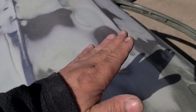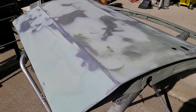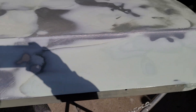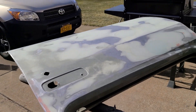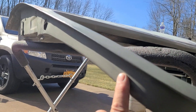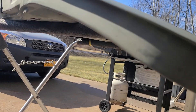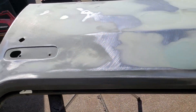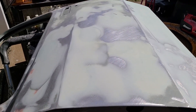At the end of the day, this door had a big cave in it and it cranked the metal — I had to do a lot of body work to get the metal flat again. But we're in good shape, we're liking it. I want to show you this — it was all wrinkled up and dented, I pulled most of the dents out, put a thin skim coat on there, and you'd be hard-pressed to find any damage on this door now. Most people would have just got an aftermarket door, but I have a mental block that says if you can keep the original metal, you're always better off. This is Bry — I got to get on down the road.